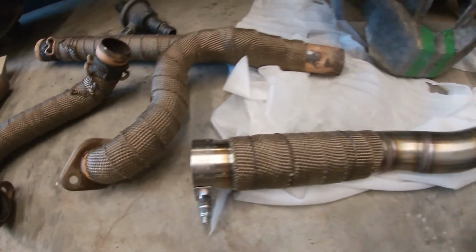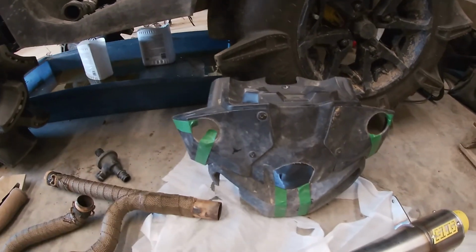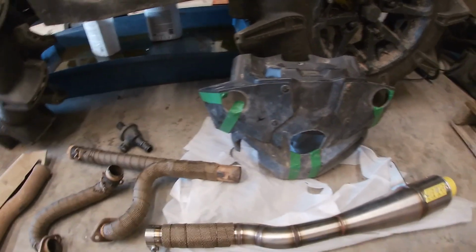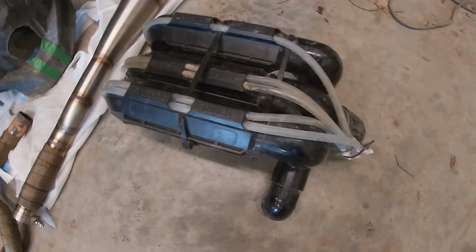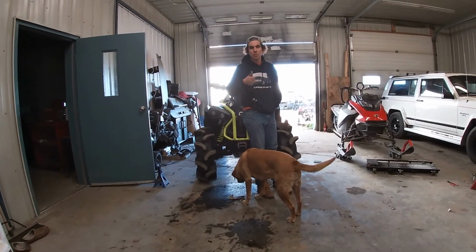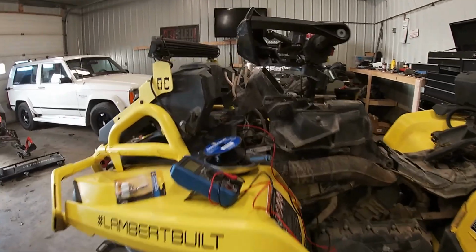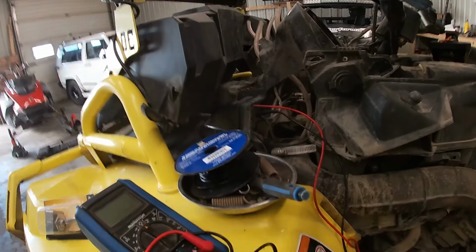Same with there, boom. So we're gonna seal up his snorkels, and then we're gonna cut these so we can actually glue everything. Nothing was really glued, it just wasn't the best. So now it's gonna be sealed right up to the snorkel. So stay tuned for reassembly, and we're gonna keep going on this build, me and Marsh. He's working on the thermostat delete, and I'm gonna start wiring in the fan override on fused ignition ACC power.